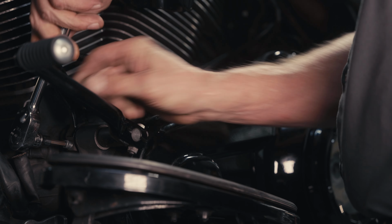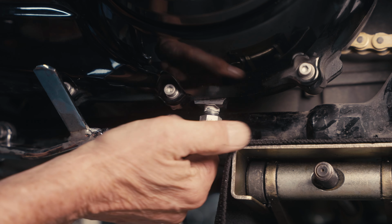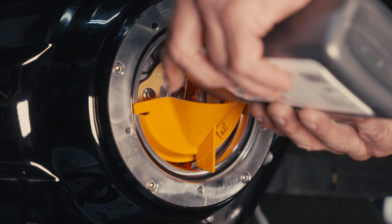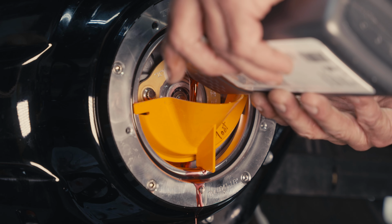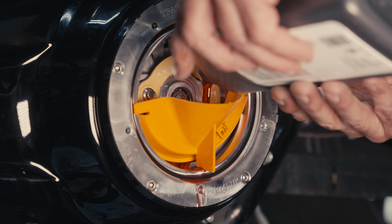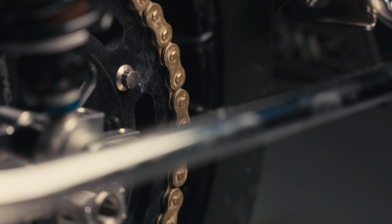Install a drain plug with a new O-ring and a little bit of Teflon pipe dope. Primary chain case oil. I do recommend primary chain case oil as opposed to Syn 3. It is designed for use in a clutch drive compartment and has more friction additives for better adhesion of your clutch. We're done with our Trask chain drive installation.